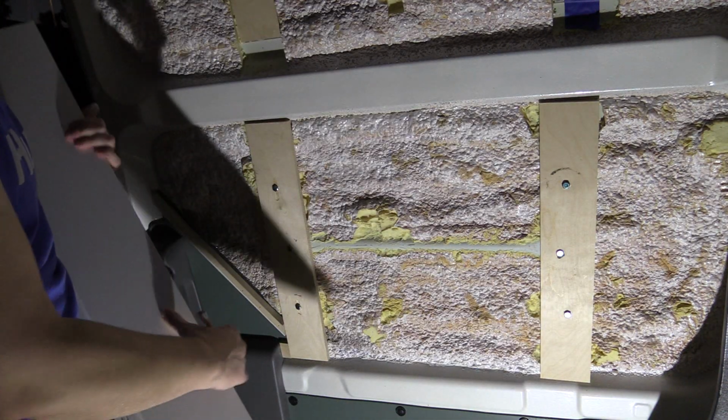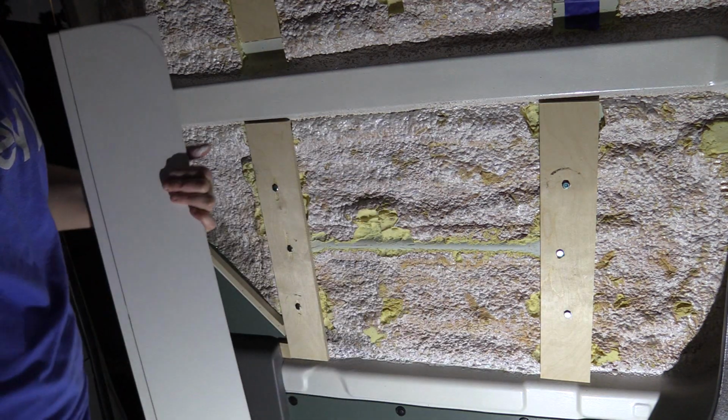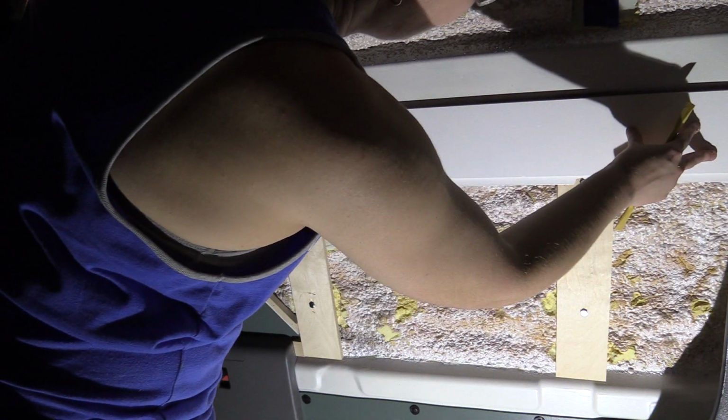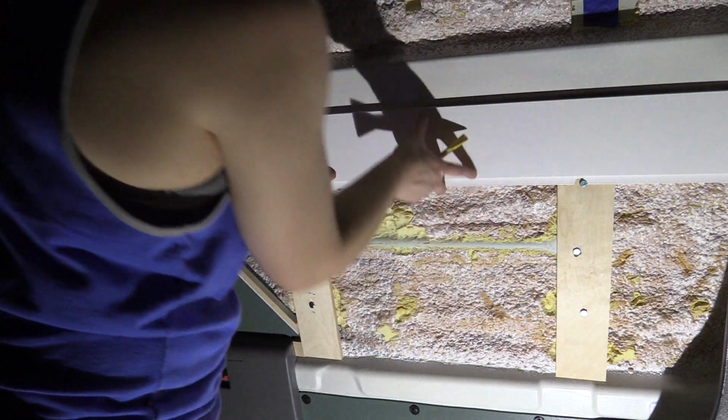And then cut it back a little bit more, come back, scribe a little bit more, and just keep getting it closer. Now, not only do you need to get the arches right, but then on the ends, if you also sand and round over the back sides, then you're able to get a much tighter fit because the van's going to be coming in at weird angles here.